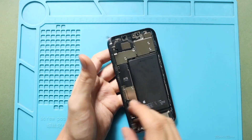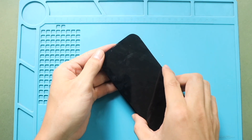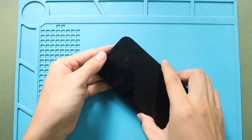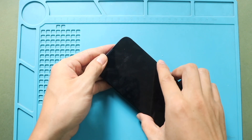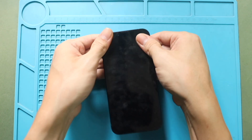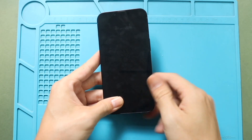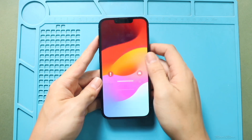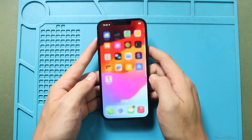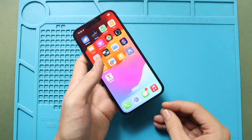Next, lock in the top section first, then simultaneously click the sides and the bottom to clamp up the body and the screen. Just make sure to apply pressure on the frame sides. Next, secure the phone by adding two screws to the bottom.